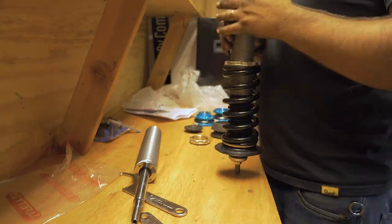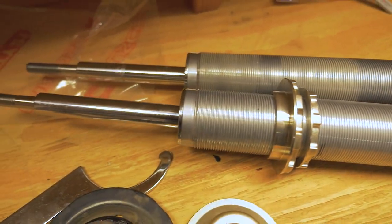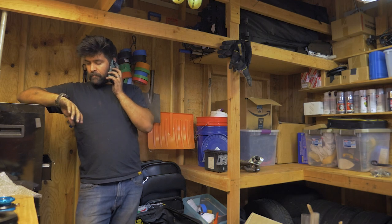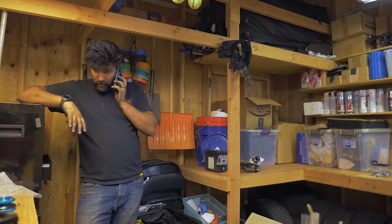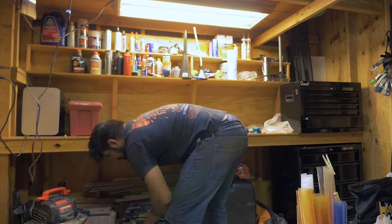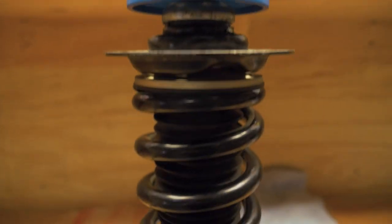The reason I'm replacing the core is because the damping adjustment is broken. I started pulling all the parts off of the threaded core, noting where everything was, but once I had it free I started to notice a difference between the two. The new inner core was the only reason I needed to mess up my alignment — if I hadn't had to pull it out, we could have kept the same alignment and I wouldn't have to spend money getting it realigned. So the old core is going back in. I might not have damping adjustment, but at least they'll be the same size as the other side. I don't know if the valving is different with the larger one, so I want to make sure it's at least balanced.